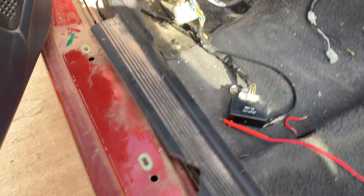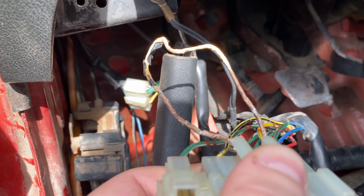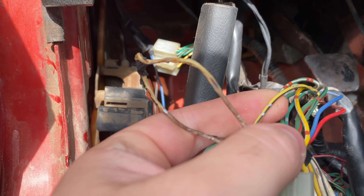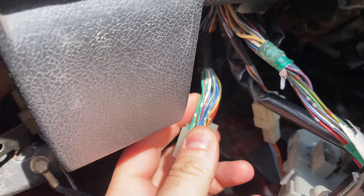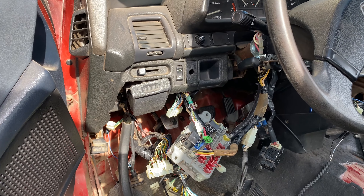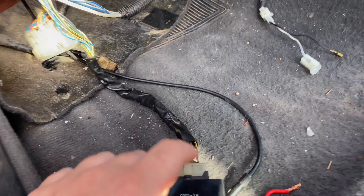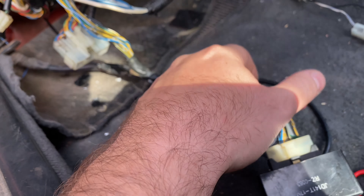It's the next day. I ended up working on this car till like midnight trying to figure out why the fuel pump wouldn't power on. I followed the wire through here - it doesn't go directly to the main relay. It comes up over here where there's a very beautiful melted wire. This is our fuel pump wire right here, and that goes on the fuse box, then connects to something that goes somewhere into no man's land behind the dash.